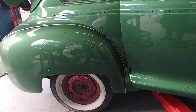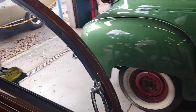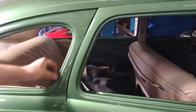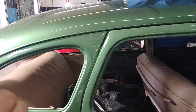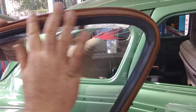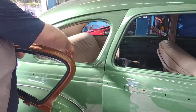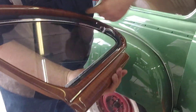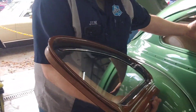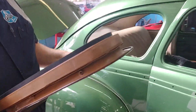Jim, how does this fit in from there? That goes on the inside of the car. What happens is I've got to put the stainless trim that goes around here on. This actually goes in from the inside and the lip on this rubber on this 48 Dodge pushes up against the stainless trim. And just by installing the interior screws, that'll push it up against there and seal it and mount this window in the back of the vehicle.